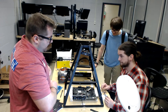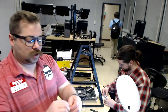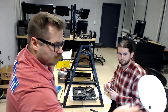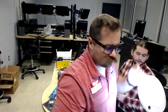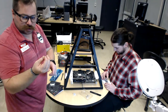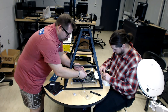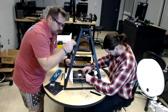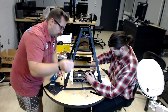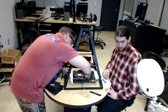So you have to check the length of your M.2 drive. Notice how when you put it in there was nowhere to mount it. So we're going to go ahead and screw this in. Again, this is the little mount. So what we're going to do is I'm going to hand tighten this down. These are very small. You don't need a lot of force. But we take the M.2 drive and we measure on the motherboard where it actually needs to go. There's actually four mounting points, and this M.2 in particular goes to the second to last one. So that's where I'm going to install this very tiny screw. And I'm just going to hand tighten it. Again, these are very, very tiny. You don't need to put much force.